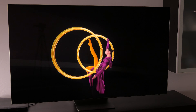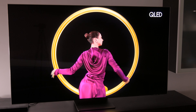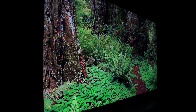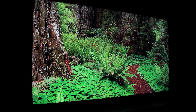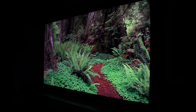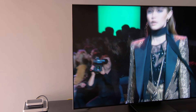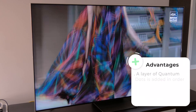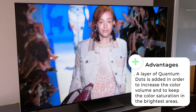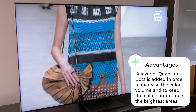The combination of this high brightness with a very effective anti-glare filter that reduces a big amount of reflection makes this TV perfect for watching in a very bright room. The QN95A series also includes the ultra-viewing angle filter, which maintains almost the same picture quality when viewed from an angle, preventing a loss in color saturation and contrast. Thanks to the use of Quantum Dot technology, which consists of adding a sheet covered by millions of nanocrystals in different sizes, color gamut reaches almost 100% of the DCI-P3 color spectrum, and colors aren't washed out in the very bright areas.